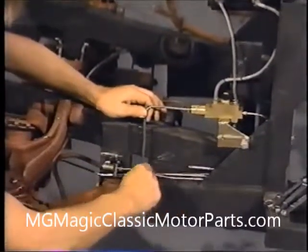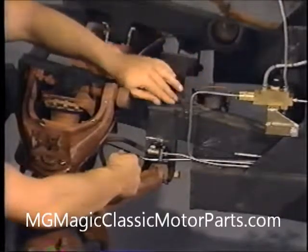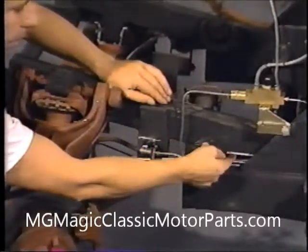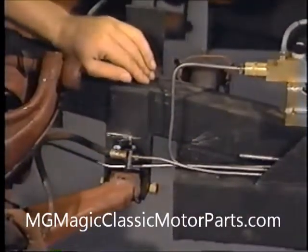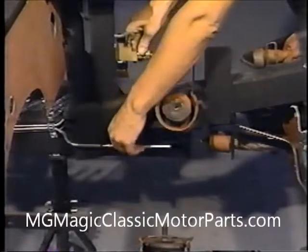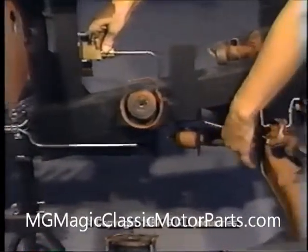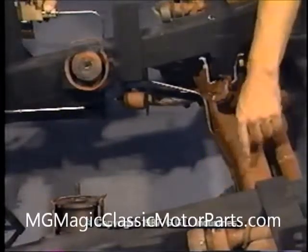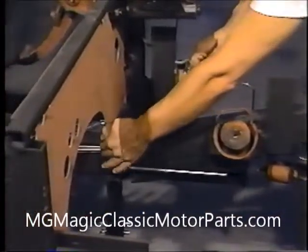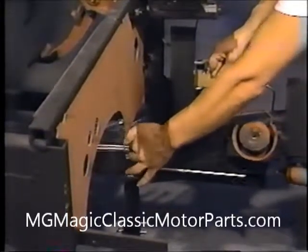Our original Chevette fitting was installed on this brake line — it has a metric thread, so we had to remove the fitting that came on the line and re-flare the line after the new Chevette fitting was slipped on. A local service station could have performed this operation for us. The fuel vent line that runs to the charcoal canister ends just below the front of the differential valve. Later, a piece of rubber fuel hose will be used to connect this line to the charcoal canister that will mount against the frame above the strut. Here we have our fuel feed line that will be connected to the fuel pump — it runs back along the frame to the gas tank and will be connected with rubber fuel hose. The right front brake line runs along the bottom inside lip of the front crossmember to the frame above the right strut bracket, where it attaches to the right rubber front brake hose. The fuel feed line runs back along the inside of the driver's frame rail, where it meets the rear brake line and fuel vent line behind the firewall.